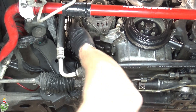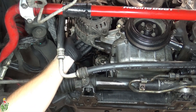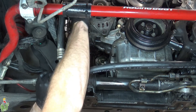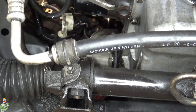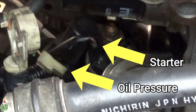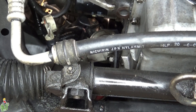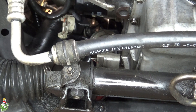The next step is to remove your alternator main wire connector — it's kind of tricky and there are entire videos dedicated to how to remove this. Push on the side on the left of it and you have to push pretty hard to get it to budge. Remove this positive power terminal bolt. There's a pin connector connected to the oil pressure sensor with the yellow wire, and then there's another one connected to the starter — that's another pin connector you can pinch with needle nose pliers to get it to come off. Next, remove the large 12 millimeter power terminal from the starter, then remove the terminal from this bolt and make sure the harness is free.